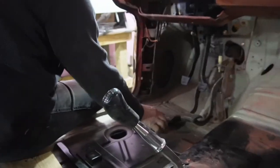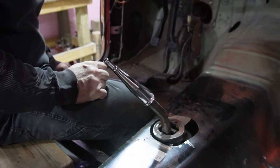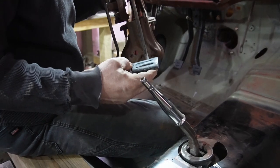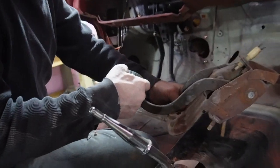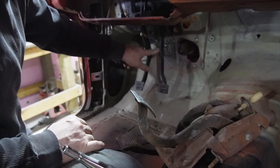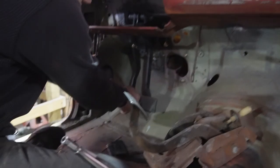Do you want pedals like what's in the Malibu? We could. I know we've got the gas pedal laying around here someplace. I don't know where it is at the moment, but we could take some 14 gauge, take these apart, make pads very similar to these, or we could cut this, but this actually is history. Somebody might be able to use this. I'm kind of reluctant to just hack this up. But we could take 14 gauge, replicate these, weld them to the pads that are existing on this G-body pedal set, and literally put the Corvair pedal pads in here, like so,